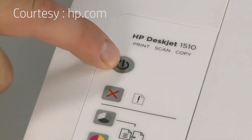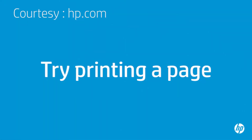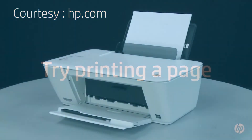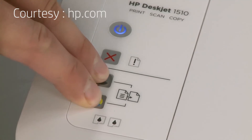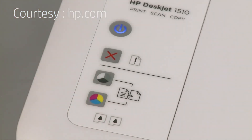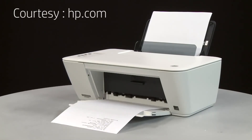Return to the front. If the printer does not automatically turn on, press the power button to turn it on. On the printer's control panel, press and hold the Start Copy Black button and the Start Copy Color button at the same time. The test page prints. If the page prints successfully, the issue is resolved. If you're using a USB cable, reconnect it to the printer and resume printing as normal. If the page does not print, go on to the next step.